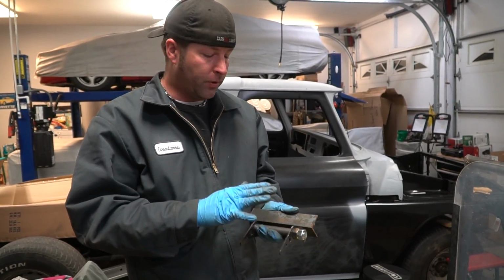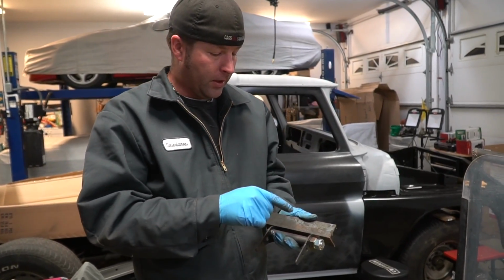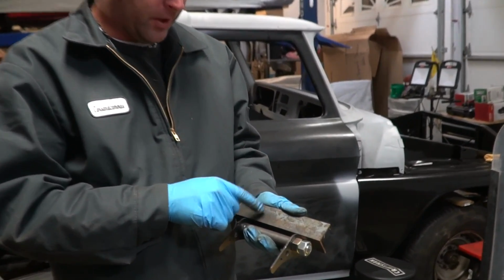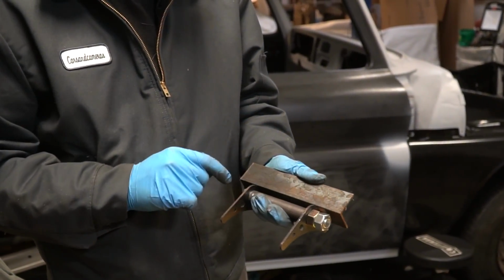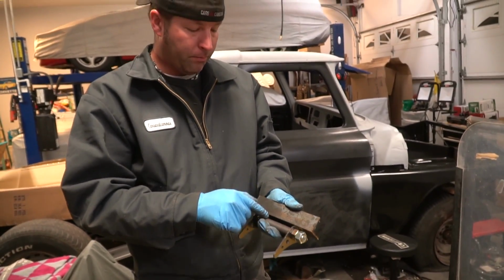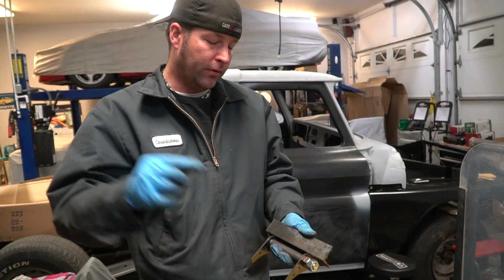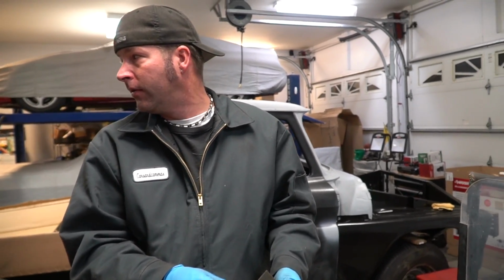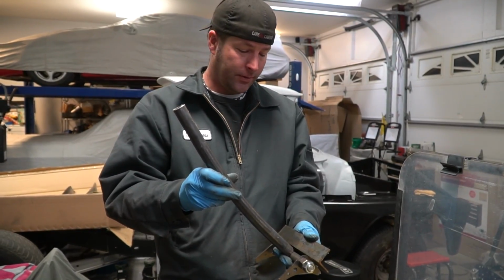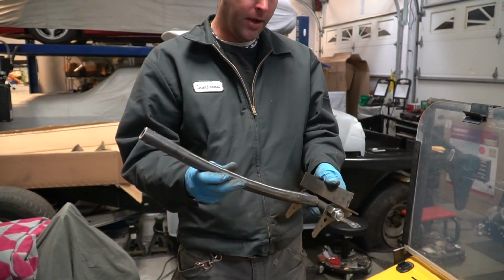So this is pretty much what I have for what's going up underneath the cart. This part is going to be welded to the frame. These gussets from Go Power Sports are going to be welded to this angle iron, and this pipe right here is going to act like the pivot that is attached to the banana piece. The banana piece. Where is it? It's going to be welded to this, and it's going to allow the front suspension to pivot up and down.